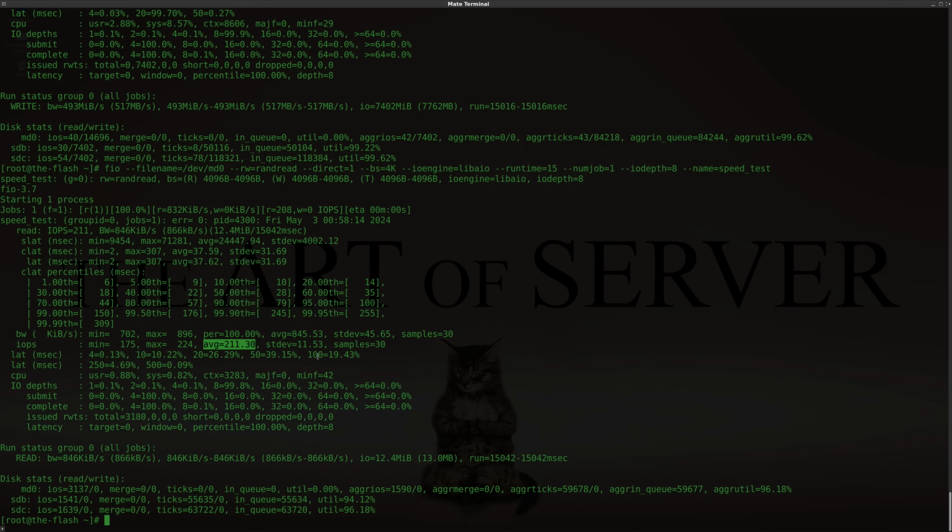Now, again, this might be a result of, like I said, in order to really take advantage of this technology, you have to lay out your data just right between the two sides of this drive, this Mach.2 drive. And so it might be the case that the Linux software RAID-0 isn't optimal for that, because we know each side could have done 130 IOPS. So in combination, it would have been 260, but we're only seeing 211 here. So as far as trying to accomplish the double the performance claim that they're saying, I think it involves a little bit more detail there.